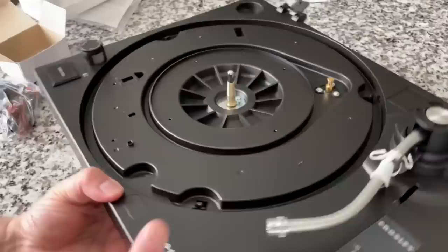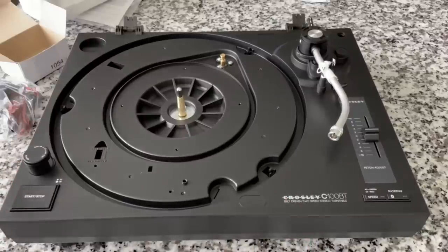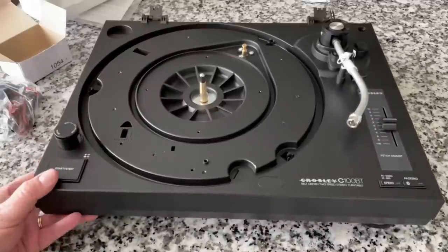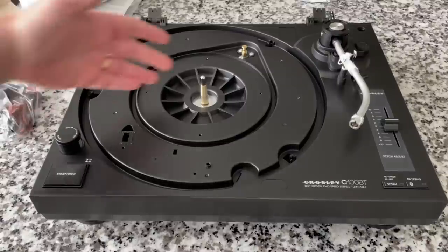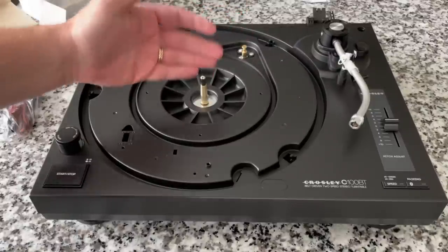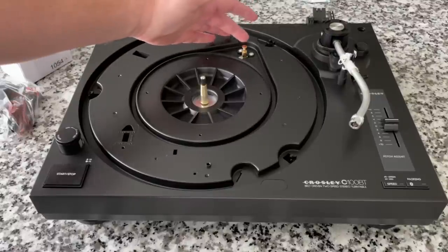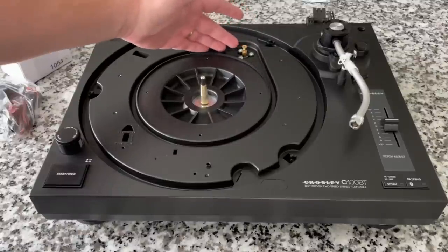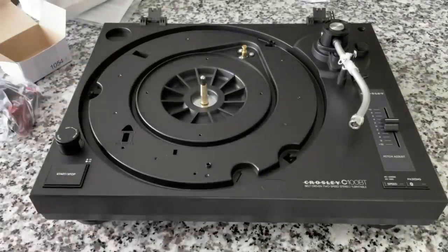If you're not doing DJ work, there's not really a major benefit unless you need your record to spin up 20% faster than a regular record, which I've never thought to myself, dang, this record's just taking too long to spin up. It never happens. So the benefits, actually, audiophile turntables opt for a belt mechanism because there's that rubber separating the motor from the platter. And the reason why that's important is this vibrates. No matter how high quality of a motor you have, there is motor noise, and that will get transferred either more so with direct drive or less so with a belt to the platter, which is then picked up by the stylus and tone arm, which you can hear as platter rumble, motor rumble.